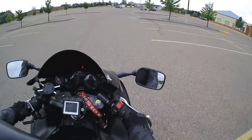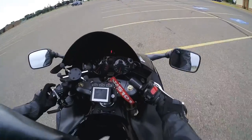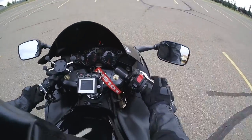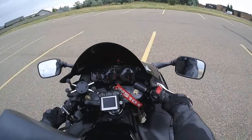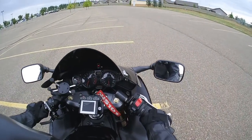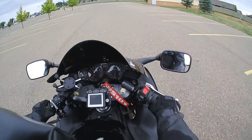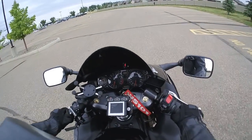So yeah, when you come into a stop, I'm going to try to line it up again so that I'm running flat here. It's going to land on an even surface. Clutch in and then down, and you can see I'm going down. And you can feel the second it touches. It's an awkward feeling for a biker to feel, something just come out and grab you, but it grabs you and it's secure. And you can cruise with these down. I wouldn't take it out of first gear, that's for sure, but you can rock back and forth on the landing gear. That's why it was designed to have a little bit of play in it, so you could tip from side to side a little bit.